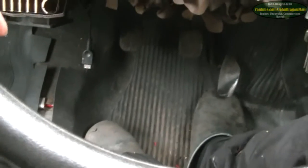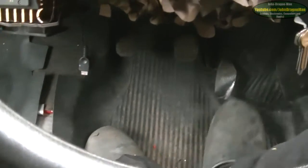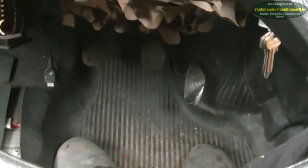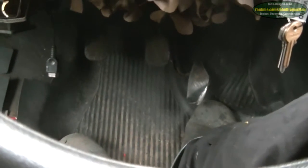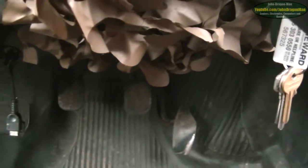The difference is quite impressive. In the other little Fiat Panda with the standard carburetor engine, you have to use the whole of the throttle. In this, you've only got to use like that much, and then you've got all of that extra throttle travel which is extra power. It's amazing what difference fuel injection makes — it really is. On the motorway, my foot was normally pinned, but in this you've only got to have it down a little bit and it stays at the speed.